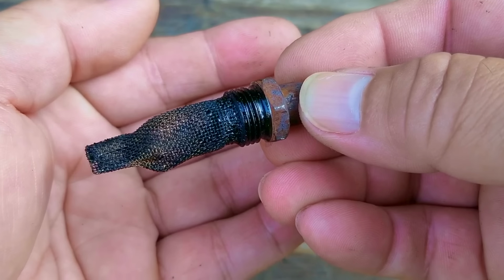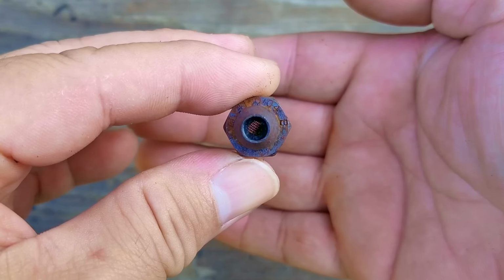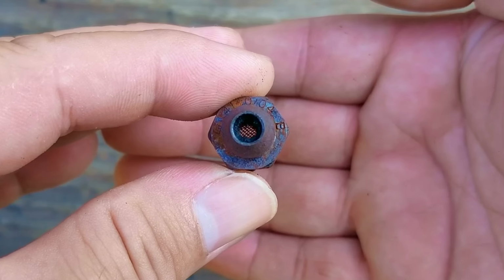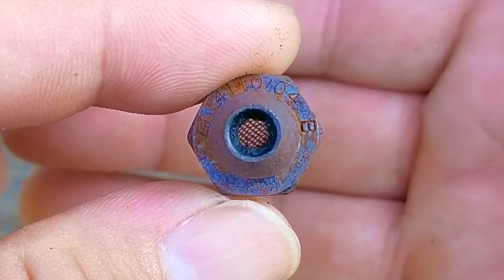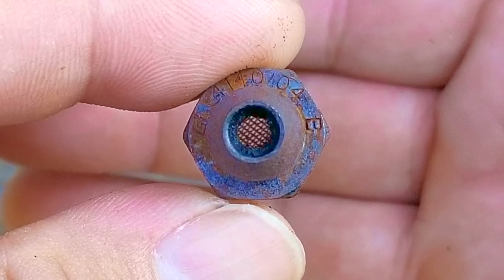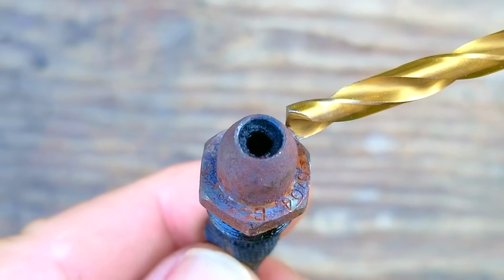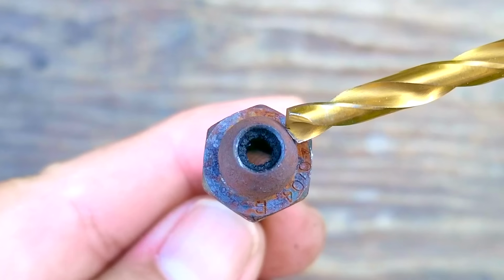If we look at the exhaust outlet for the spark arrestor, you can see into the screen and see through it, but what I wasn't looking at was the diameter of the opening. What I didn't realize was that there was carbon buildup on the inside of it, and it may not look like much, but it was enough to restrict exhaust flow out of the muffler and engine. I realized it when I happened to start it without my hearing protection on, and realized that it wasn't all that loud, just like a clogged screen, even though the screen was clear.